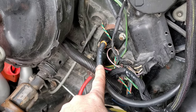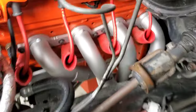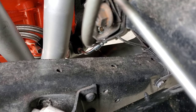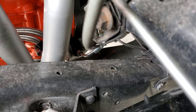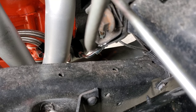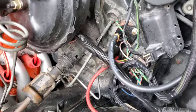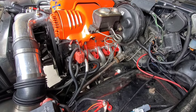Got all this installed - got the new reservoir in, the new master cylinder, new lines all the way down, and then I bled the bleeders down below. The bleeders are just right there on top above where that fitting is. What I had to do was have someone press the clutch pedal after I bled all the air out of the slave cylinder. So: open the valve, push clutch in, open, close, let clutch out, open, push clutch in, out - just repeat back and forth. Hopefully that helps you. Not a very good video, but guys hit subscribe and check out more of my videos - I appreciate you guys and hopefully you enjoy the video.